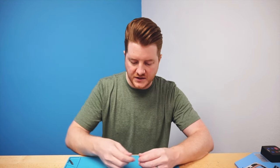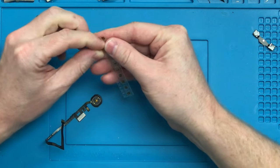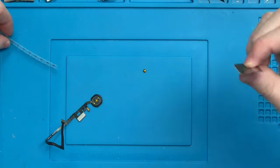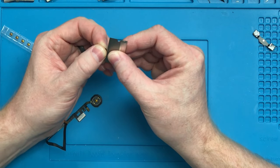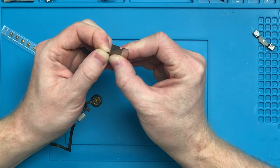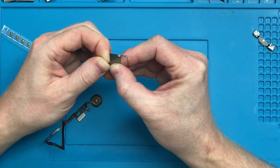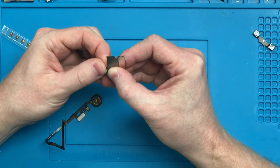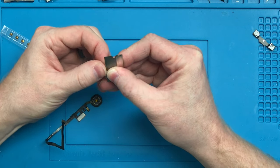The way that you remove these is go ahead and take one from your strip. If you don't have one of these strips available you can actually use another iPad home button, or an iPhone 3GS or iPhone 4 would work as well. Go ahead and take that out, then get a pretty brand new razor blade and slice off the Kapton tape. Working on one of the corners, you'll just slide this right in and work very carefully.